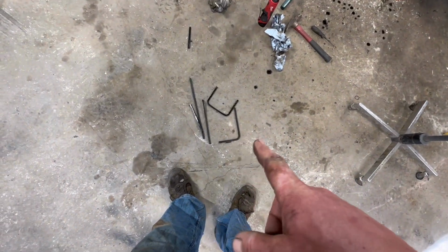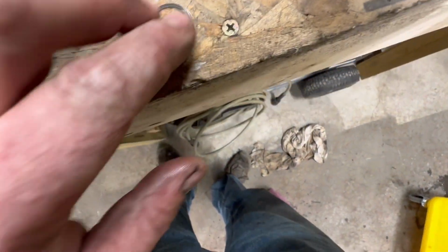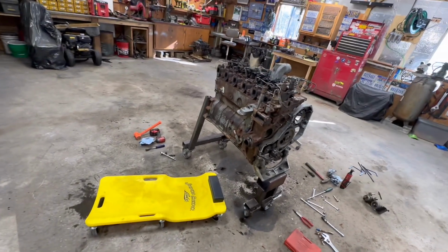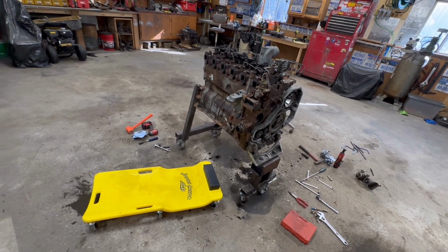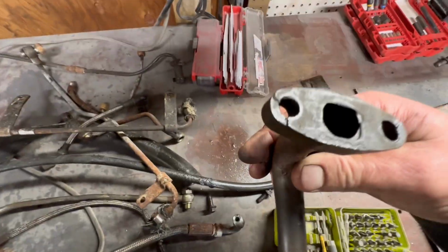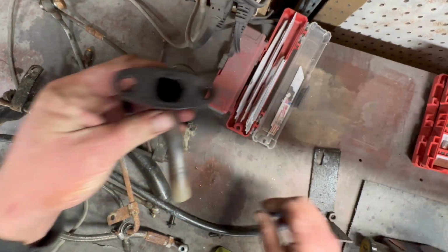And there's the remnants of the tappet cover gasket. I don't know why that thing was failing. You can see it's 30 years old, it's brittle. Only thing of concern in this whole process, I found all that in the oil pan. I'm not sure what that is, but this engine has been running great. It did have turbo failure, like catastrophic turbo failure. So I'm going to go with that being remnants of the old turbo. Obviously, any of that would easily have passed through the turbo drain. You can see if I set you up there, even the biggest piece comes right through.